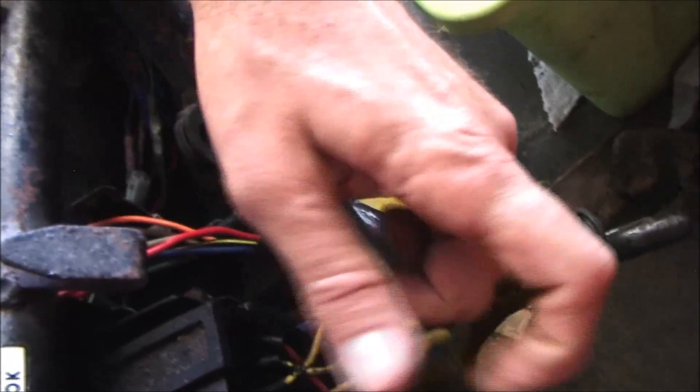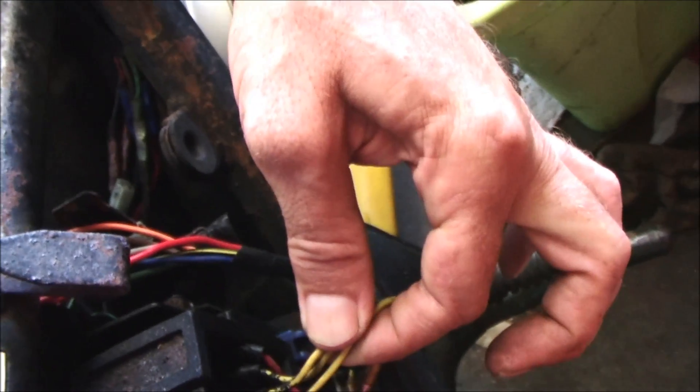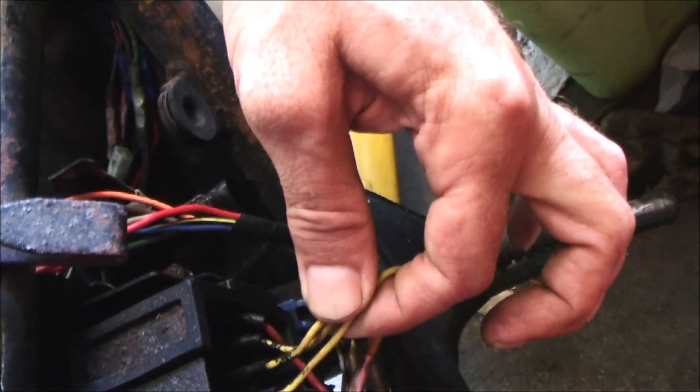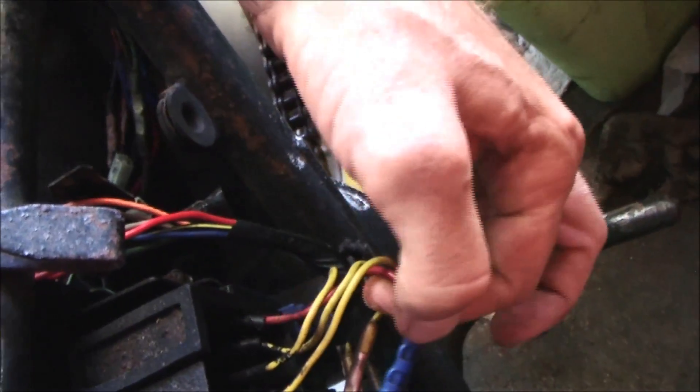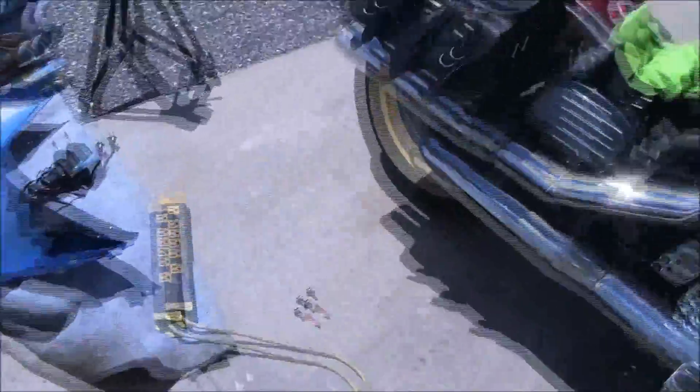Testing these things is pretty easy. If you know you've got a charging problem, you're always gonna have three AC leads — I don't care if you've got this style or the other style of rectifier. Those three AC leads, if they're within five volts of each other, nine times out of ten that stator is good. Your hot lead and your ground — in this case a case ground — your hot lead should be throwing over 12.